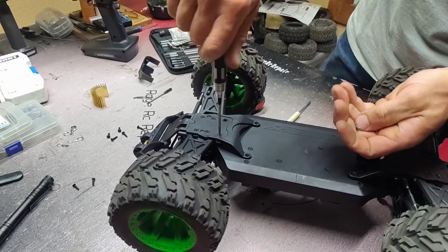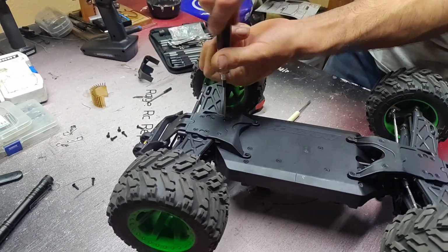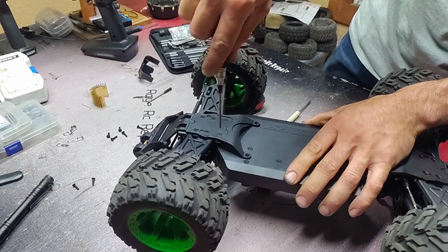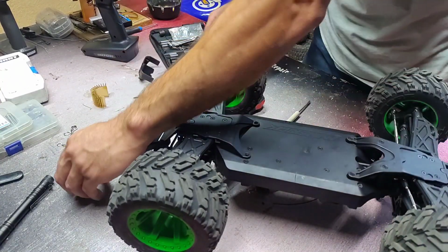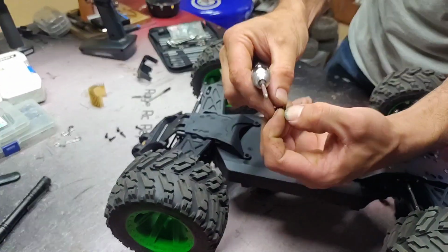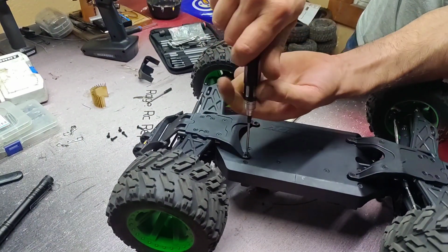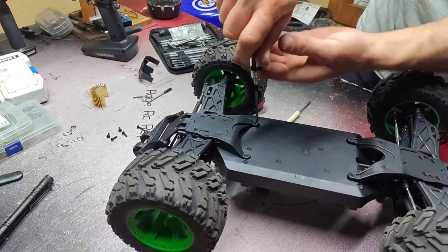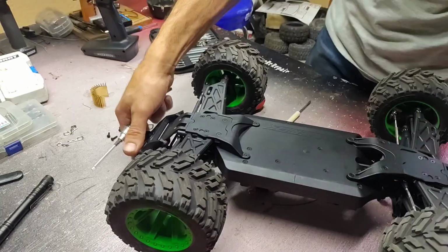And we'll slide those back together. Make sure those are nice and snug. You don't have to try to break your screwdriver or anything, just snug them down, because remember, it is aluminum on the bottom, but it's still plastic where it's seating. And then you have the other two tapered head screws, which will go in the front. We'll get those lined up, put back in place, and then we'll flip it over for the rest.